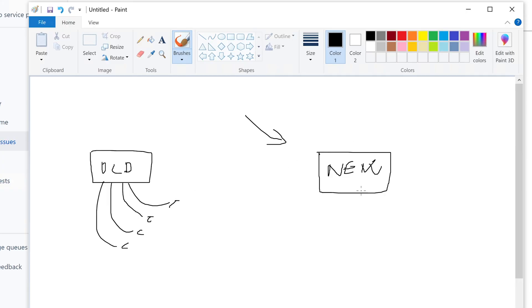So what I did was run a main cable from port one on the new router slash modem, and then ran a cable to the old router right here, plugged that in, and now I can use the old router and set it as a bridge.